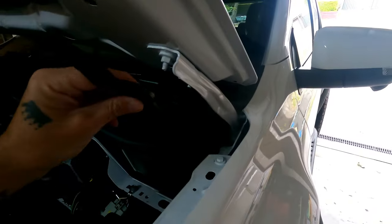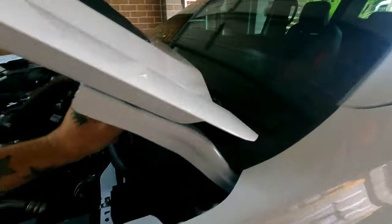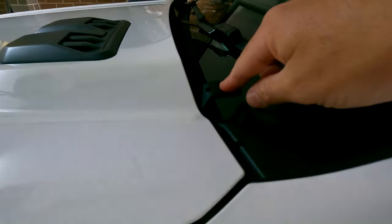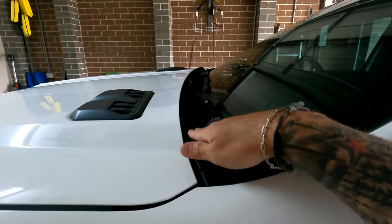Pirate Camp Co bracket literally just goes on there. Just be careful when you unbolt your bonnet — you'll see that's sort of the way it's going to sit. Just a simple, sleek design. We'll get that bolted up. 13mm bolts on the bonnet — just make sure you hold the bonnet when you undo it so it doesn't slip down and hit the glass. Just a tiny little bracket — it sits pretty stealthy, nice and flush, nice and flat.